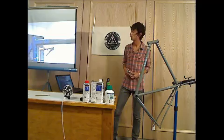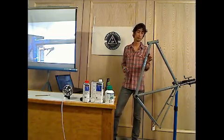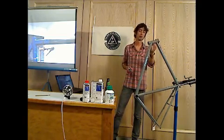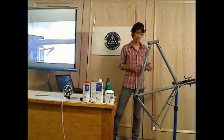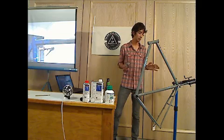You can definitely still polish stuff out, because things are going to happen to it. There's going to be little dust nibs in there, even if your booth is pretty clean. So you're going to always want to polish those little nibs out. But you definitely want to get that nice texture, because you're not going to be able to change that too much.